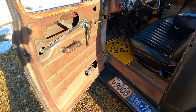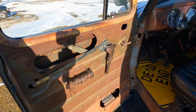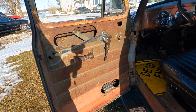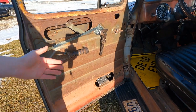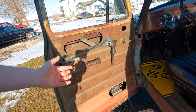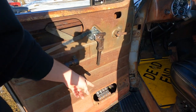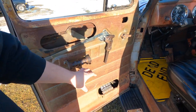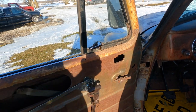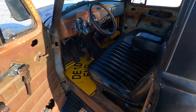So I got a camshaft as my door pull, and an old adjustable as the handle to open the door. And then I really wanted electric windows. So we had a parts truck behind the barn that had some electric motors in it, and I got some relays down there to reverse the polarity on a micro switch I have in this wrench, so that you can flip it either way so that the window goes up and down, and both sides are done like that.